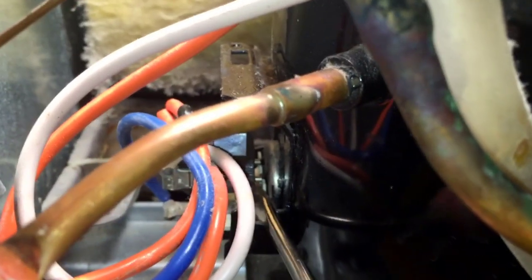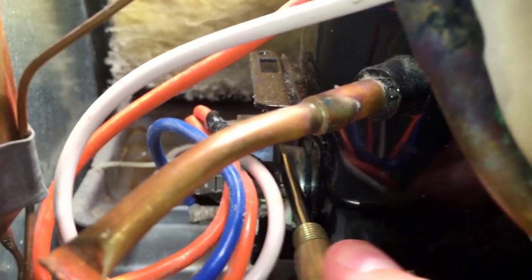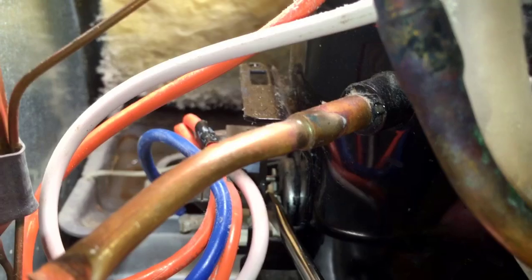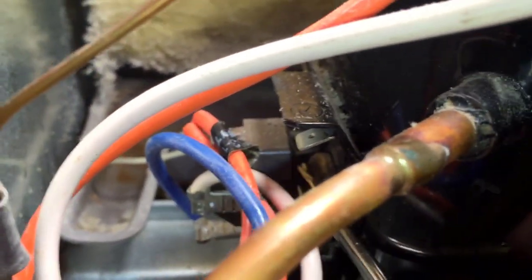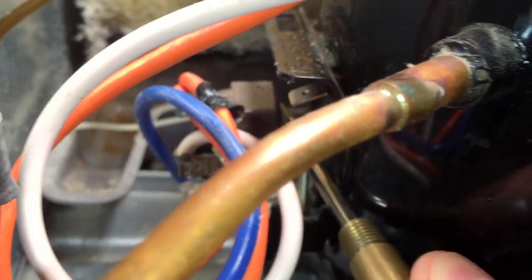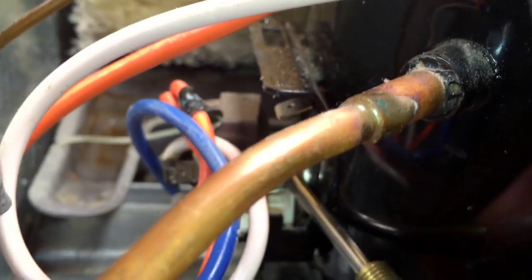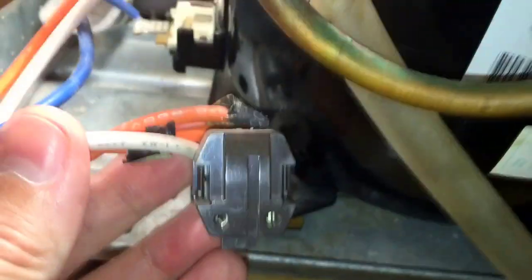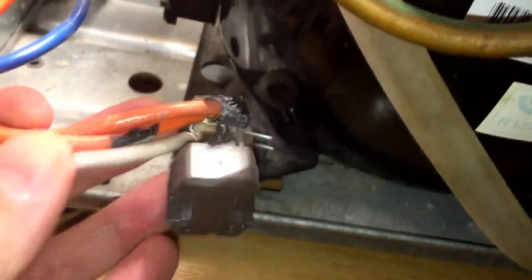Now I need to release the PTC start relay, which sits on two pins sticking out from the compressor. Carefully, using a screwdriver, move the start relay away from the compressor until you can take it off completely. These start relays have been used on all refrigerator compressors back then, but now they are being phased out by newer technology. So if your compressor has the start relay but does not work, try replacing the start relay and your compressor may restart once again. But first, you need to make sure that your compressor is not shot dead, which I will cover in the next step. This is how my start relay looks, but yours may be a bit different.